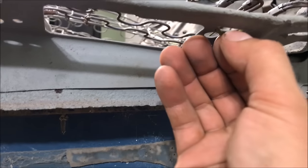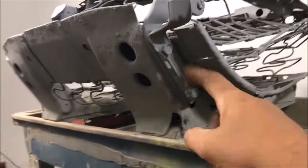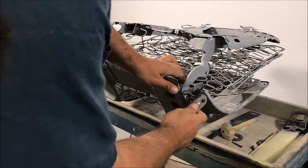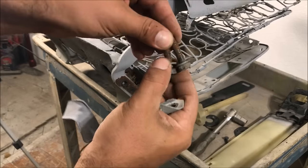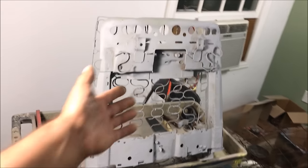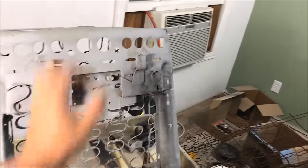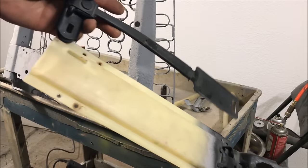If you have one or two missing tabs, just bend a little coat hanger like this, stick it in there, tape it — whatever you have to do to secure it. Once you put that hog ring in there it's never coming out. Inspect these and make sure they have a place to hog ring. Then we're going to take these bolts out of both sides and separate the top from the bottom. The screws are similar to door hinge screws with a smaller washer — 5/16 coarse thread.